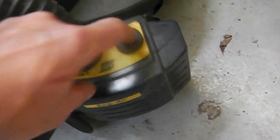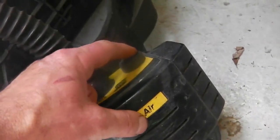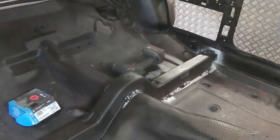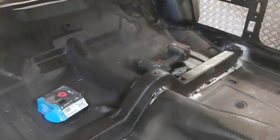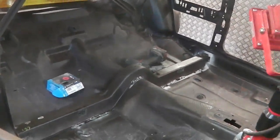Here's your air fed box. Got a filter pack in there, new one. That just force feeds air into the helmet there. I'm just concerned in here that there'll be some paint burn back. So I'm not taking any chances with any fumes. I'm really susceptible to them. We'll also open the door. We'll hear the blackbirds. So we'll be nicely ventilated.